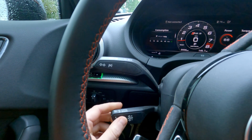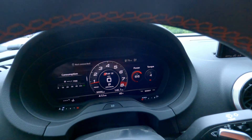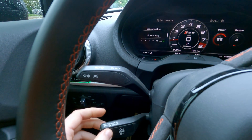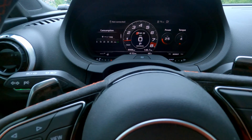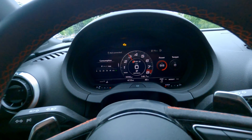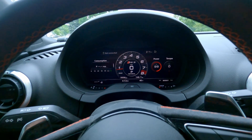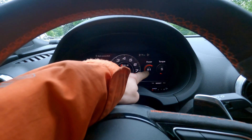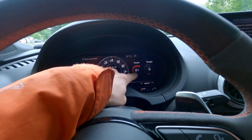We'll go off, on, off right away. Gauge zero is ethanol content and boost in bar. To switch up and down use the speed control. Gauge one is regular power and torque just like OEM. Gauge two is charge temp on the left and boost on the right in bar — we've got 25 degrees C for charge temp and 0.4 bar. Gauge three is lambda and knock — we're at 1 lambda. Gauge four is fuel pressure: six bar on the low pressure side and five megapascals.